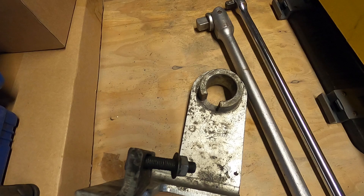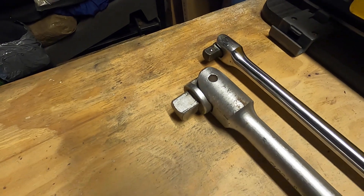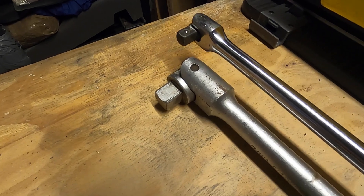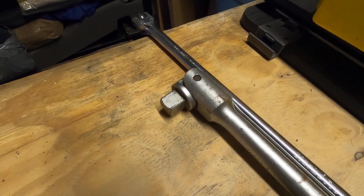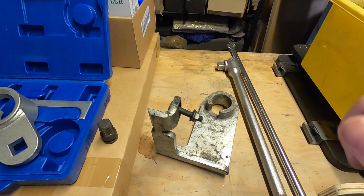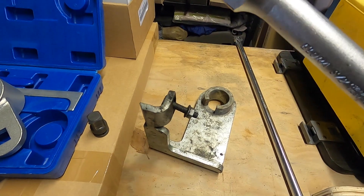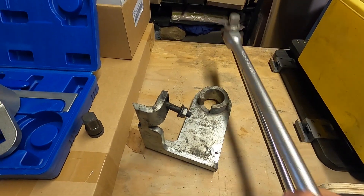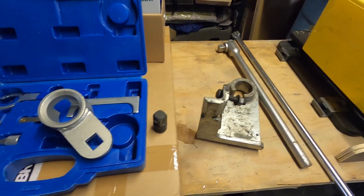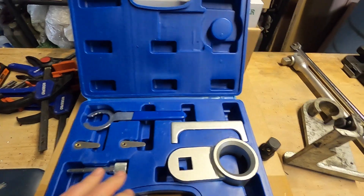This is my half inch bar — a four-foot-long breaker bar, which is very useful. You can see the difference in beefiness between a half inch breaker bar and this three-quarter inch breaker bar. I want to be using this big bad boy as much as I can, because the impact wrench will only tighten it up so much, and then you have to torque it and then do an extra 90 to 180 degrees with something like this. I suspect I'm going to need to put a pipe on the end to get that accomplished.